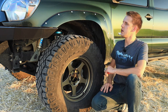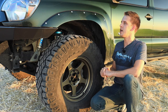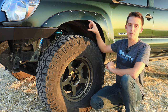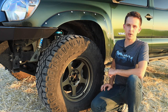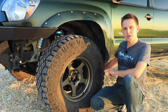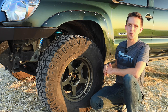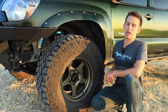While we're talking about tires, I'll talk about clearance. You'll notice I've trimmed the fenders quite a bit — actually not necessarily for tire clearance, but because I think the factory Tacoma fender flares are just huge and disproportionate. I trimmed about three inches off, so the truck is actually sitting relatively low with maybe an inch or two of lift. For other tire clearance work I've done: tweaked the suspension alignment, did a cab mount chop, and a little bit of additional trimming. I broke a few clips on the fender flares during trimming, so I have stainless steel flatheads holding them on — not my favorite look, but it keeps them on the truck.